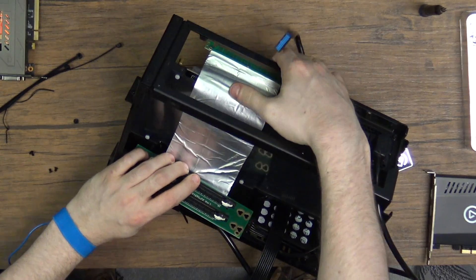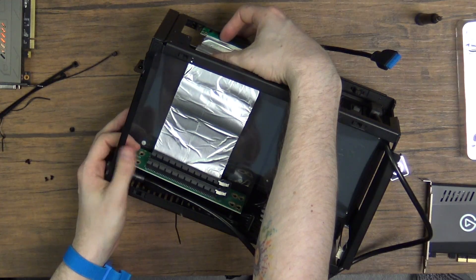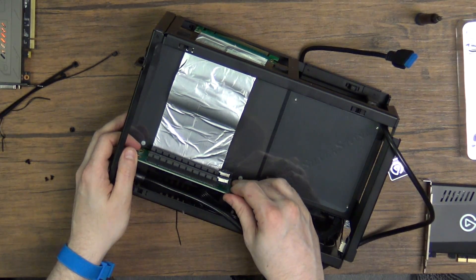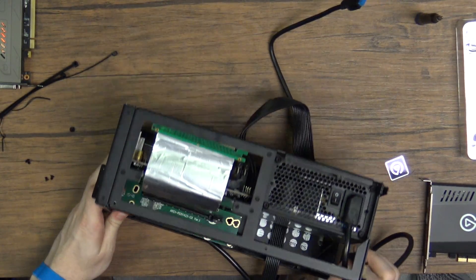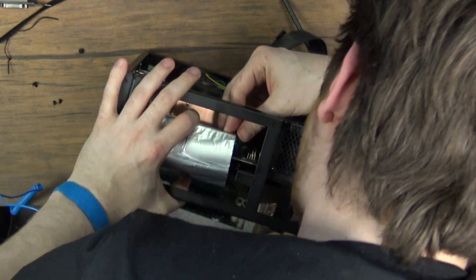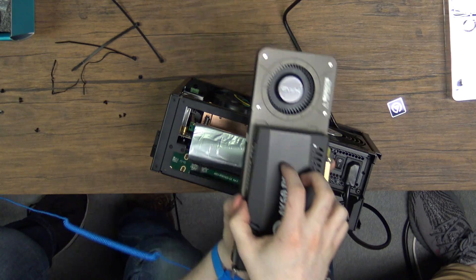So this is the bifurcating adapter. It's going to sit on top of these screws. I'm going to 3D print a bracket that screws onto this and goes through the case. The slot covers will hold the cards — it would be hard to mount a graphics card on its own in this, but with the Elgato also weighing less than a graphics card but still screwing in, we should be alright. I want the Elgato on the outside-facing slot for two reasons: one, it looks nicer than the graphics card, and two, the graphics card is a blower-style card. So as long as the Elgato doesn't overlap the blower — which it doesn't — it actually gives it more space inside the case to move air before it hits an obstacle. It's actually way better this way around.